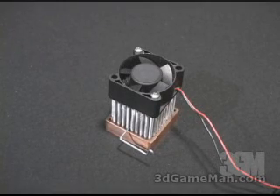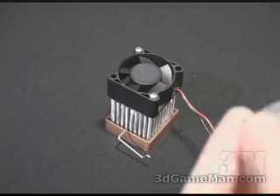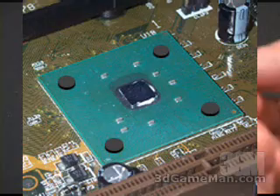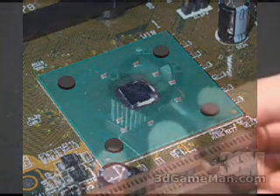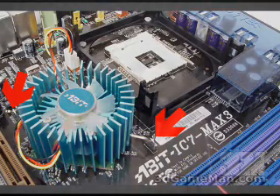The retail version comes with the wire spring pre-installed for installation on Intel processor platforms. This is very easy to install — you do not need to remove your motherboard. However, you do need to remove the existing chipset heatsink or cooler, clean the surface with some alcohol, and apply thermal compound. Then place the four neoprene pads on the chipset on the motherboard, place the cooler on top, and snap it into the loops on the motherboard.